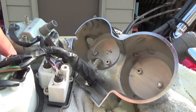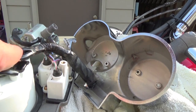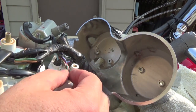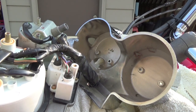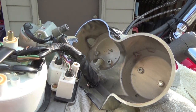I'd already replaced these three bulbs and the small one, and these five. But we saw that the turn signal bulb I can't change out because it can't be polarized — it should have the ability for the polarity to be switched because of the way the relay works for the flasher. It's not a solid-state unit.